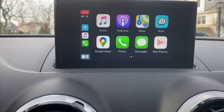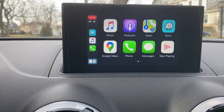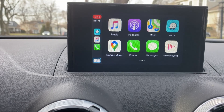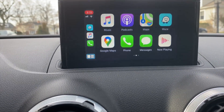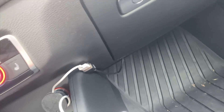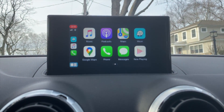A little while back I installed an Apple CarPlay mod from a site called Carlinkit — I linked the product in the description to that video. It added the capability of having Apple CarPlay in my 2016 Audi A3, which does not come with CarPlay originally. I have a USB cable there which I'm going to change the routing of, and I'll show you the installation process, including routing the Wi-Fi antenna if you want to use wireless.